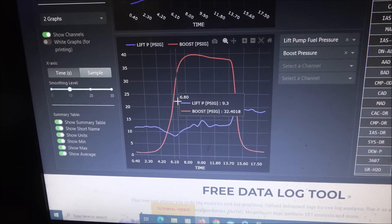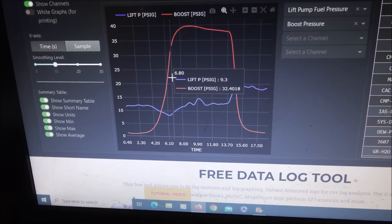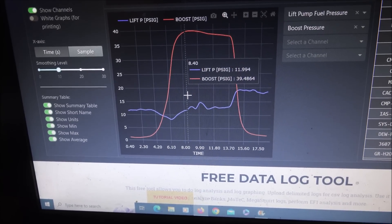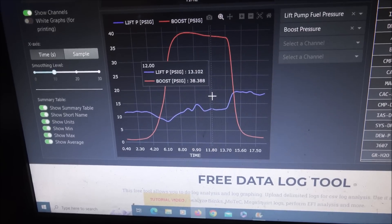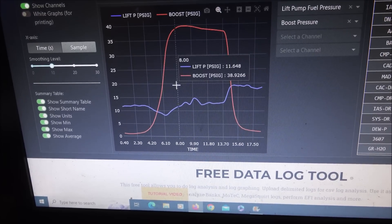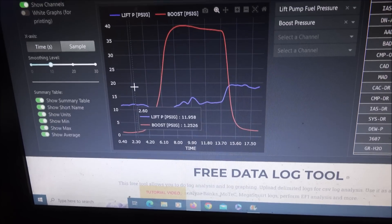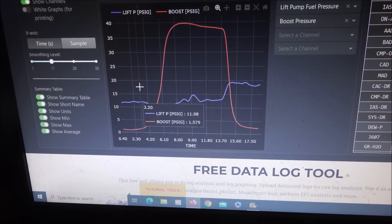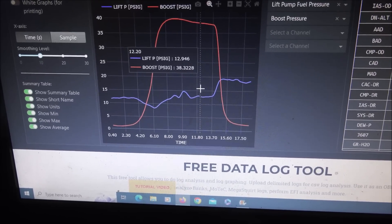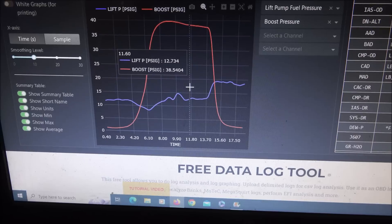A little adjustment to the fuel pressure regulator and setting it up in the mid PSI range — there you can see it cured the fuel pressure problem. I'm now running 40 pounds of boost and able to maintain fuel pressure of roughly 12 pounds. Idle's not real high, and as the RPM comes up the pressure comes up with it. I'd like to boost-reference this so it can follow it even more, but simple is also a good thing for a daily driver. I'm satisfied that it's working okay.